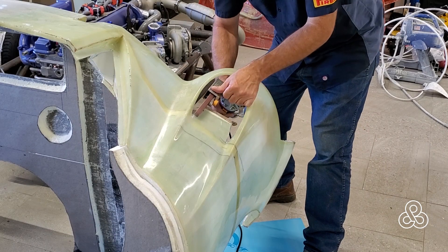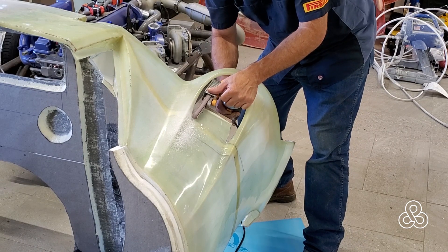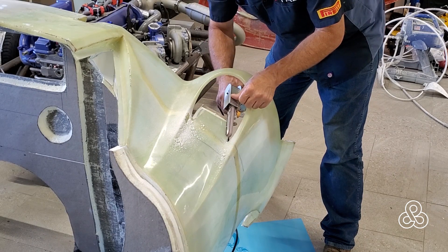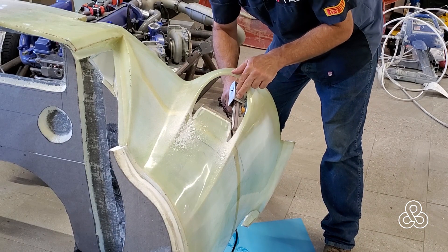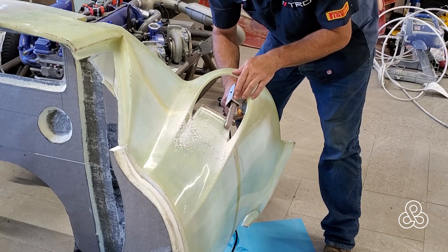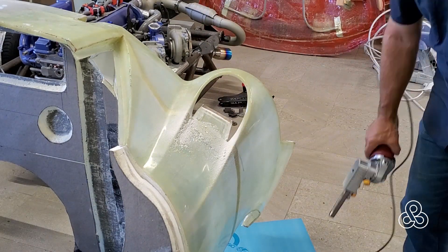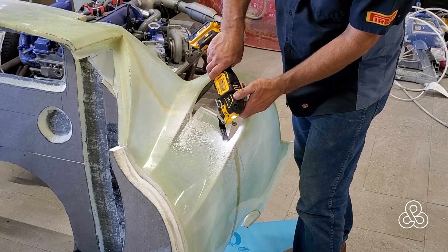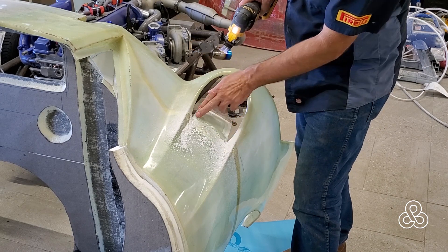When this came out of the mold, this part had a little bit of a turn up, and even after I trimmed it out that little kick up needed to be ground down so that we have a continuous smooth surface across this little tab that we've left here. Got this little miniature belt sander out and made quick work of grinding that down. But even that little belt sander can't get quite into the tight little corners, so back to my favorite little tool — this little oscillating cutter — right down into those corners, making sure everything is smooth.